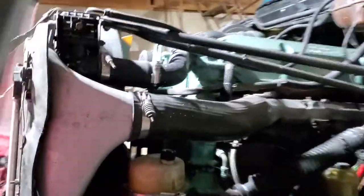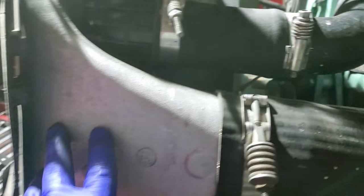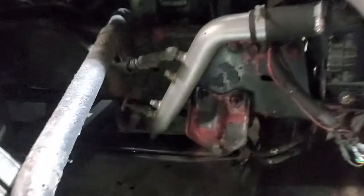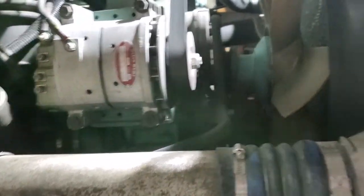You're going to want to open up your hood. I built a little stand to bring the radiator up so my straps are slack. If you're doing this by yourself, you're not going to be able to push the hood up and try to re-bolt it. I have an air cooler to disconnect, the condenser to disconnect — and that's going to get me to the radiator. Get a couple of empty buckets, grab channel locks, and put a bucket underneath so you can drain all your coolant out, because you're going to want to drain your coolant or you'll have a big mess.